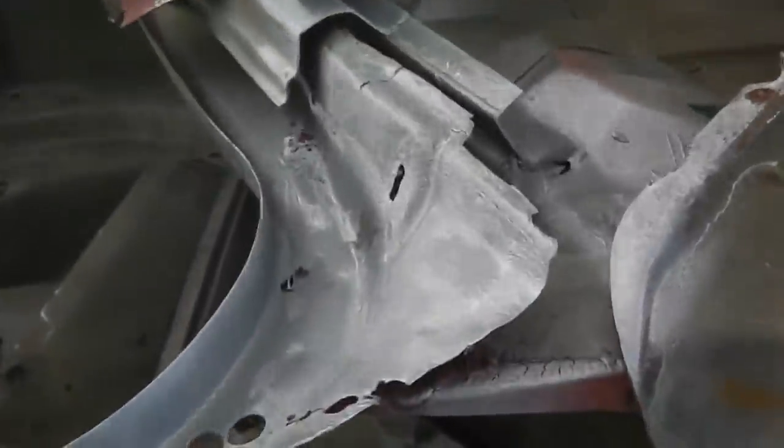What I did, I had to weld the little fillet piece. I'd forgotten about it. See that fillet piece just there? That enables me now to slide that in. So don't worry about the weld through primer changing colour. I just wire weld it back and then just touched it in. It scratched it off. Right, now seam sealer's ready.